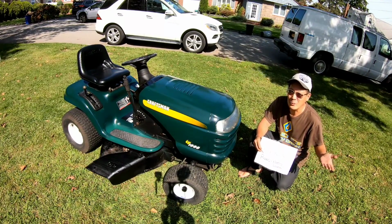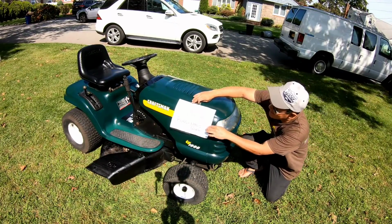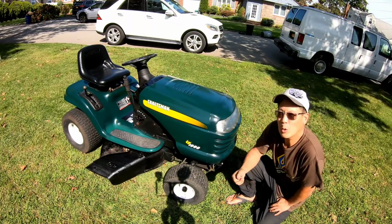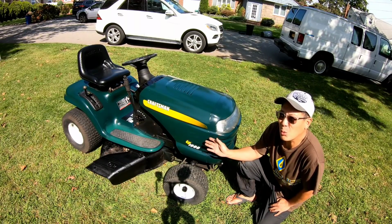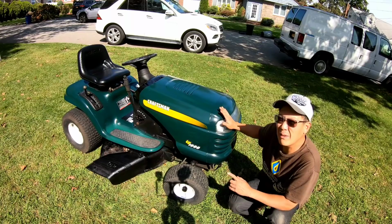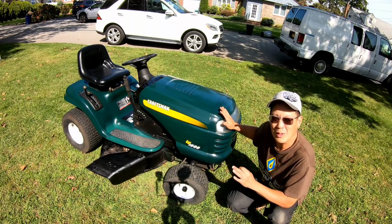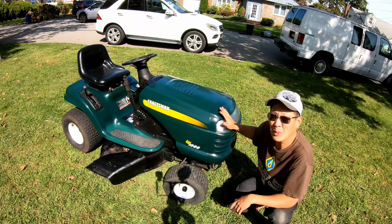So there it is. From getting a tip from Frank the UPS guy, to picking up this free tractor, runs, needs work. We did the work and tightened up the brakes a quarter turn on the adjustment. Just put a brand new battery in there. I'm in this for $28. Put ATF all over it after we power washed it. We gave it an oil change. I took the deck off, cleaned it up, repainted it, greased it. Put a new belt on there, stole a PTO engagement cable from my other one, put it on here. I just mowed the back lawn with this thing.